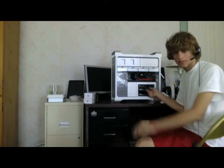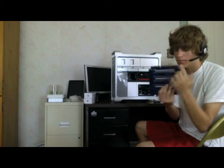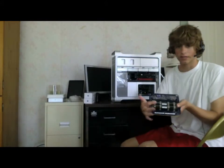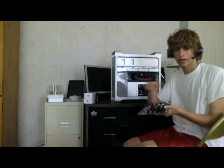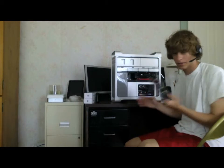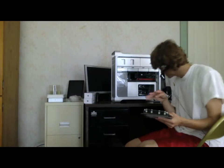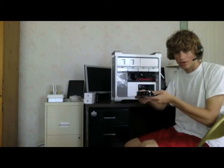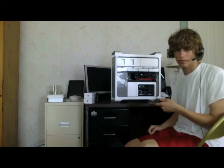To use Mac Pro RAM, there are two riser cards. These plug into the motherboard using a very large bus — the yellow here is the bus. This connects right into the motherboard. These are the one-gigabyte units that came with it, so there are four one-gigabyte units, and they all connect into this card, then go through the bus into the motherboard. This means there's less chance of the motherboard breaking since there are only two slots instead of eight, so more wear and tear goes on this card. If the memory unit breaks, you'd replace the card, which is a lot cheaper than replacing the whole motherboard.